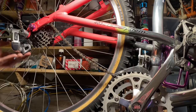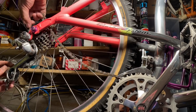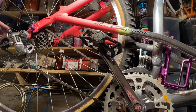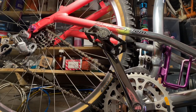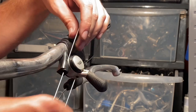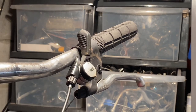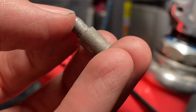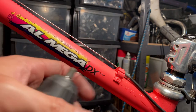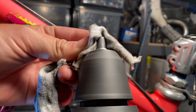Throwing the chain on now - it's just a brand new chain. You always run the risk of whether the chainrings are going to slip the chain, but luckily these ones don't - they're in pretty good condition. About the only problem I have with thumbies is that putting the cable in can be kind of a pain until you take the barrel adjuster out. Sometimes it just goes straight through, but other times it gets really finicky and you end up with a frayed cable. This is one of the cable ferrules that sits in the cable stop riveted to the frame - I don't really know why they did this style because that little bracket doesn't actually have a stop inside it, it's basically just a hose guide.